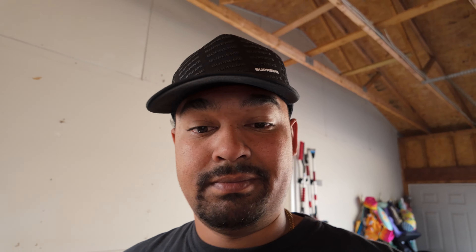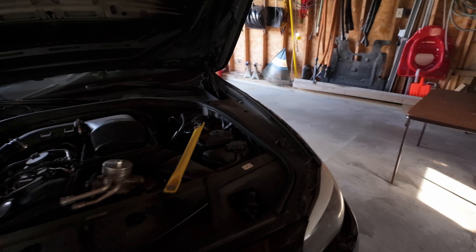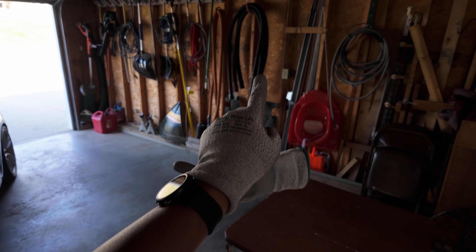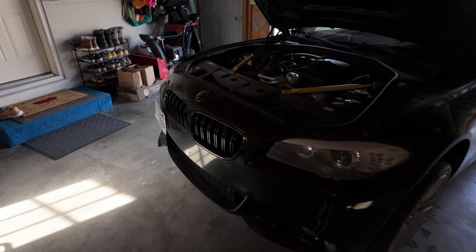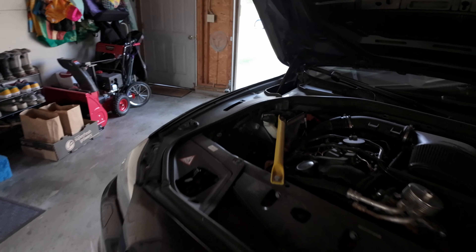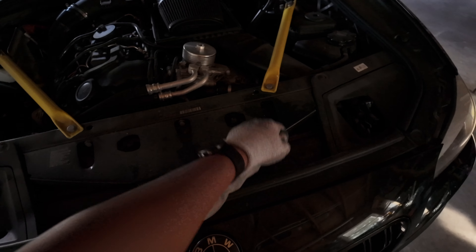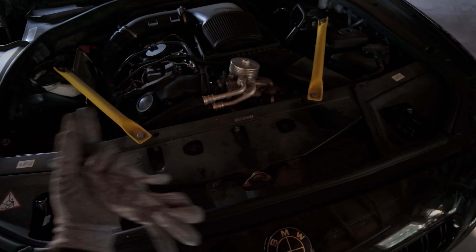For now I'm just gonna move the ramps out of the way, get the bricks cleaned up, sweep it out a little bit, get the car on jack stands — at least the front end — lift it up and start dismantling some things. The car is up. Luckily for the intercooler, the under tray, the under panel, is already off. There should just be two bolts — one over here, one over here — underneath on the bottom of the intercooler.